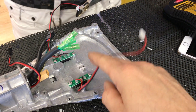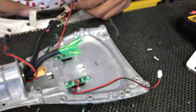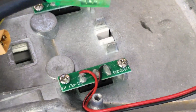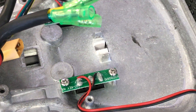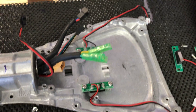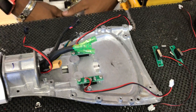Now these are your foot sensors right here — you've got one on this side and one on this side. For anybody doing this at home, we highly suggest replacing both of them. To replace both, you unscrew this part with the two Phillips head screws, and then you're going to replace this old foot sensor here and this old foot sensor here with the brand new ones that you've bought from our website or gotten from us for whatever repair issues you need.